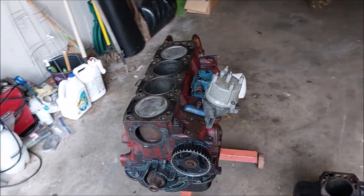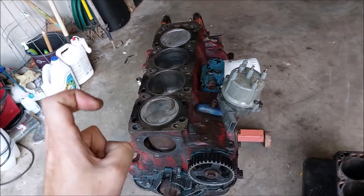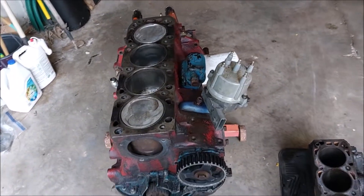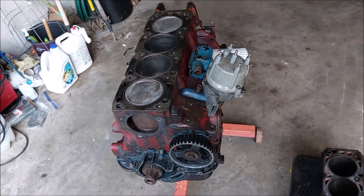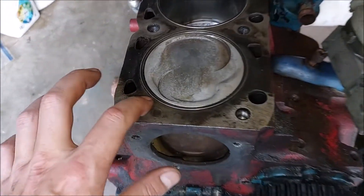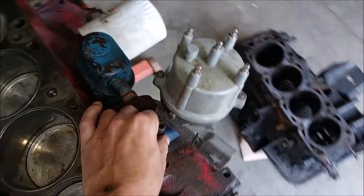Welcome back to Everyday at Race. Today I'm going to take this built 2.3 liter turbo engine apart that I picked up a while back. I was told it was highly modified and I want to see exactly what's in it. I've been told it's got aftermarket connecting rods and aftermarket pistons, and the block has been O-ringed, so it's probably going to be in good shape. First we're going to remove the distributor.